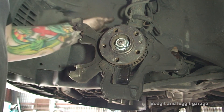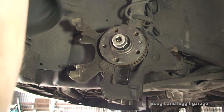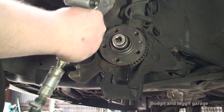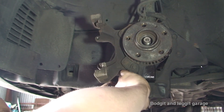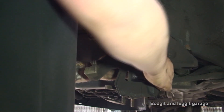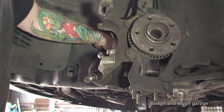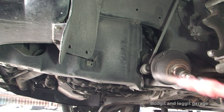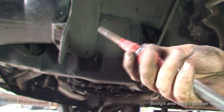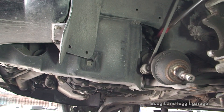I'm just going to take off this bolt first — which is a 30mm — and then the bottom ball joint, which will release this for me. Now I can start undoing these bolts. I'm using an M10 spline with a huge extension. I've had to slightly modify it because the ball's missing so it slops off — a bit of tape holds it all together. I can reach it from here with a half-inch ratchet on the other end. I'm also going to get a vice grips and put it directly to the shaft — the vice grips will hit against the wishbone, which should stop this from spinning.